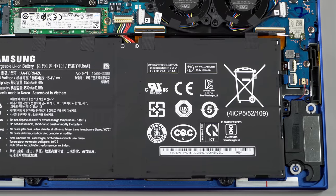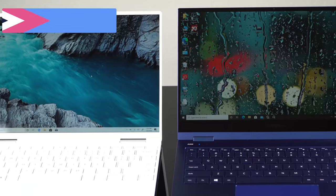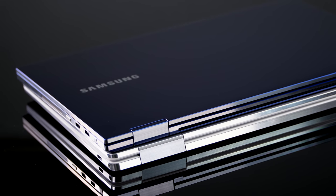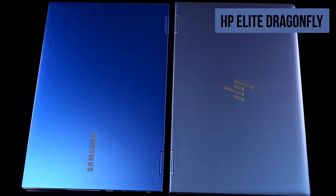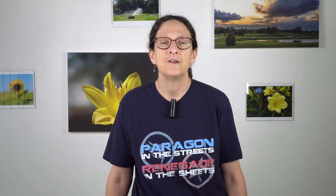So how about battery life? Something's got to give here, right? Well, this is really another great point about this laptop. It was part of Intel's Project Athena, which means super long battery life and good performance. But because this has nearly a 70 watt hour battery — 69.7 watt hours — which is unheard of big for an Ultrabook, battery life is outstanding. And there's another selling point of QLED: it's a lot more power efficient than OLED. OLED is very power efficient if you're only displaying really dark things, but when they are brighter, they use more power than an LCD or LED display. So with a power efficient display and only full HD resolution, battery life has been crazy — like 14 hours in mixed use at 150 nits streaming video.